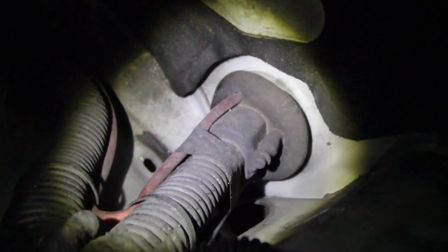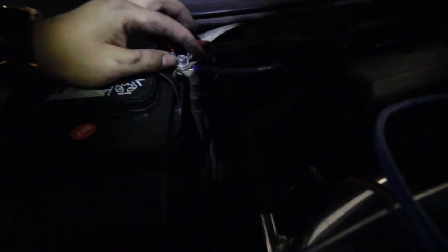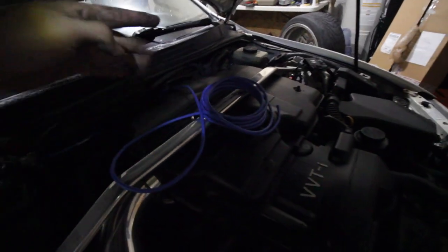The back will just break open — there's your little hole that you can stick your wire through and through the carpet too. Lift it up from here and this is where you can run your wire through your seat, then boom, to that middle seat armrest. You can also come look in your engine bay, go to where your master cylinder is — it'll be this boot right here. That red wire you see is the old power wire that ran to the back. We're going to take this old red one out and put the new blue one in. Cut that out and wire it all the way to the battery by twisting the terminal off, putting the wire in, and twisting it back on.